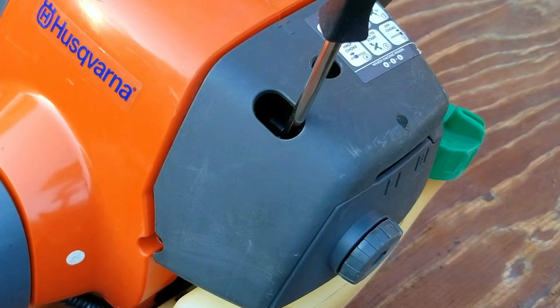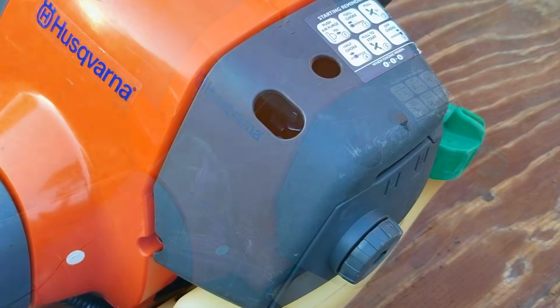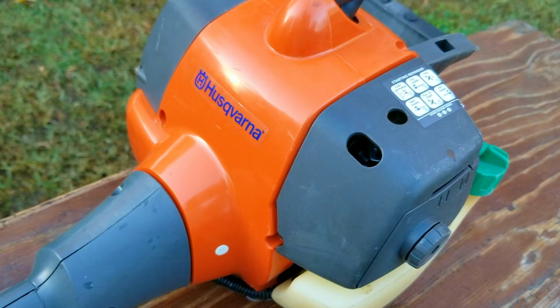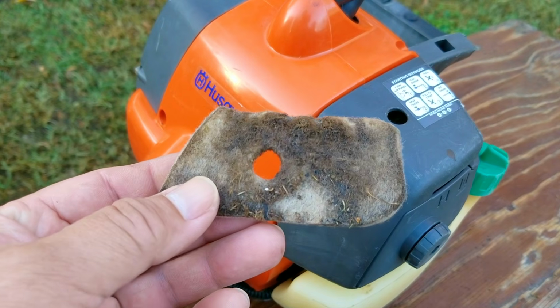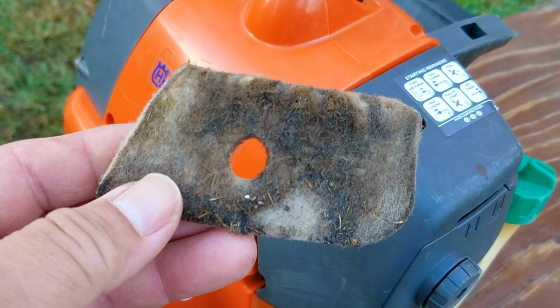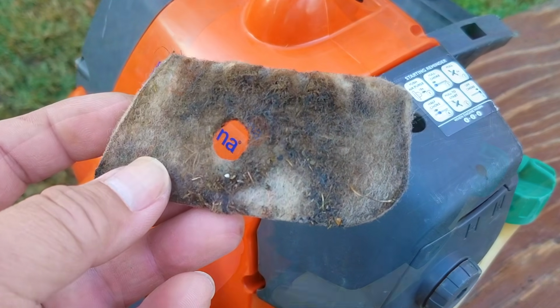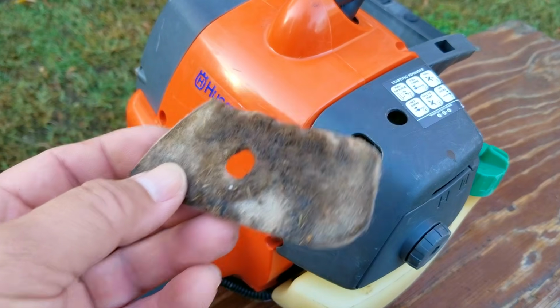And once we were able to keep it from stopping, the next step was to make our adjustments to the high-speed screw that's closer to the air filter. And to those who were paying attention, yes, I did forget to install a new air filter before I started tuning it, but even after putting a brand new air filter in, it really didn't have much of an effect on the tuning we did. I do think just getting rid of the old one was more beneficial though.